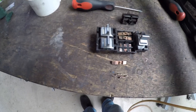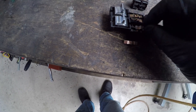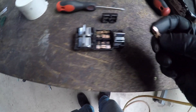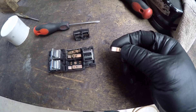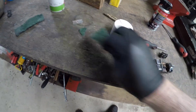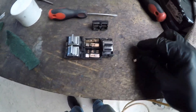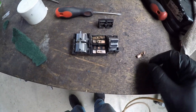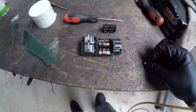I was able to get that out without it springing into bits, which is nice. This one goes back together like that. Now, the contact point — believe it or not, that blade there is a contact point, so you need to clean that up with Scotch-Brite. And obviously then your main contact point here fits onto those two little pads.